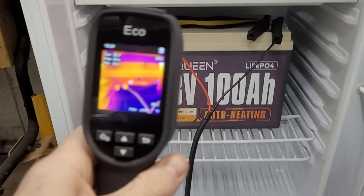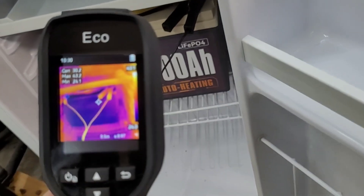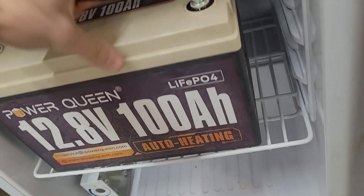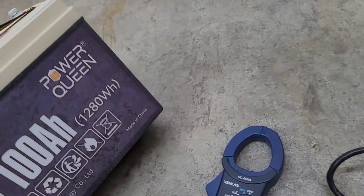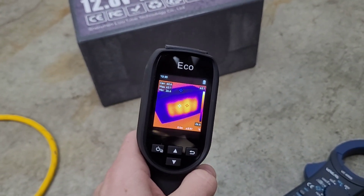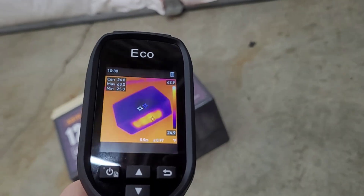The charger's been running for about seven or eight minutes. We don't have a ton of heat in the front of the battery just yet, but if you get right down on the floor you can see a ton of heat right at the bottom — looks like this one has a heating pad on the bottom of the battery pack. Let me check the back. This thing is fully frozen — look at how frosty that is. No heaters on the back. You can actually see where the frost has already thawed from that heater. We've got about 63 degrees there in the middle — that's pretty warm compared to the ice cube the rest of the battery is. It does lock out the charging and the heater does work, so that's a good sign.